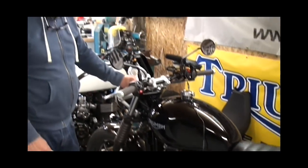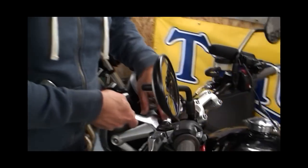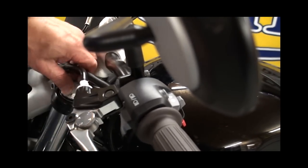Because these springs are under pressure, under the top nut you may need to move the bars about a bit to get better access. On this side you can get in here, so just undo the top nut — I've already loosened this one.